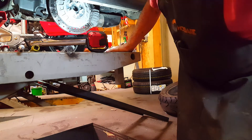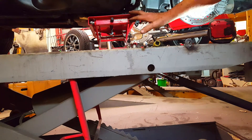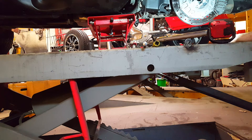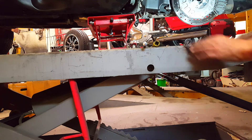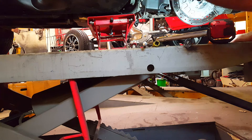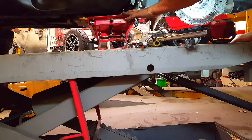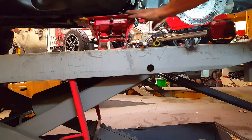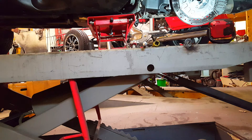Another way to do this — look at the jack I have here, a platform scissor jack I think I bought at Northern Tool. What's nice about this is the bike can't roll forward or backward and it lifts real nice. What you can do is drive onto a trailer, stick one of these under there, let the wheel stick out on the tailgate, put this underneath it, lift it up so you have clearance, drop the tailgate, and you basically have what I have here. You can use your trailer to change the tire. Those are just some ideas and they all make sense to me.